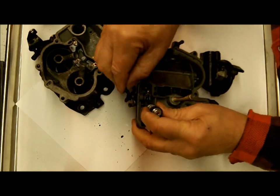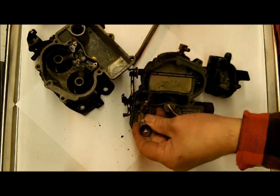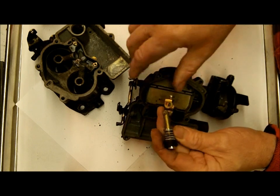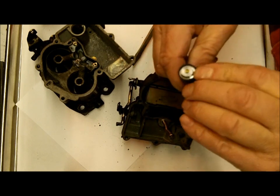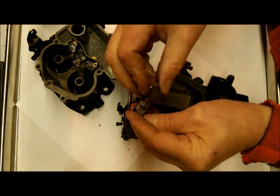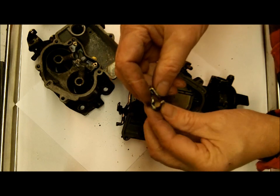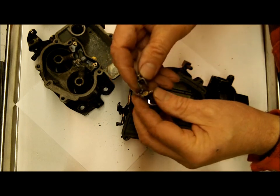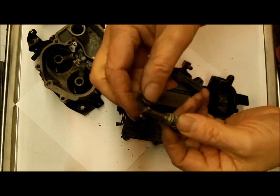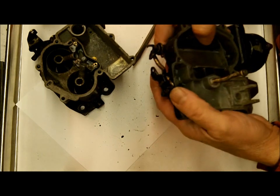Take the accelerator pump off — just loosen up the lever, and you can see how it sits in there. This one does not have a replaceable pump, so the whole accelerator pump will have to be replaced, which will be in our kit. It has a little clip on it so you can take it the rest of the way off. For now I'm going to leave it on and clean it like that, so I don't have to remember how it goes until I'm ready to put it together.